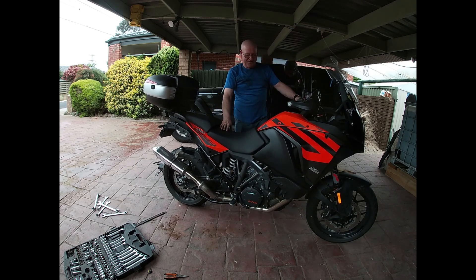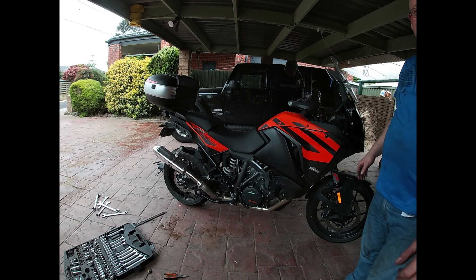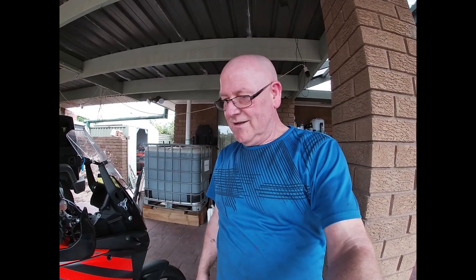You need to watch out for the side stand being so high, but I'll get that cut back. All done. So that's a wee guide on how to lower your bike 20 mil. I don't think you could lower it much more without changing the spring on the back. But yeah, I've got 31 and a half inch inside leg and I'm quite happy with that now. See you later, bye.